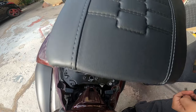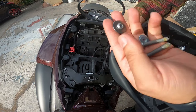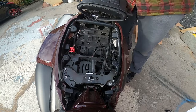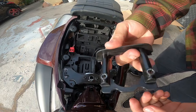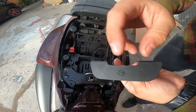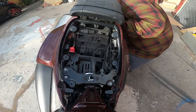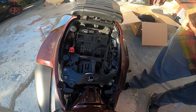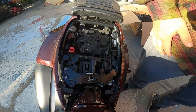Now we can go ahead and install the seat — go straight in, and then on the back you will see three bolts: one, two, three. That's where the three added bolts they gave you go. The one with the two smaller washers — those go on the outside, and the big washer goes on the inside. The spacer goes on the inside of the rear, just like this — there's a little Harley Davidson emblem and that's gonna face the back. Just find the one with the bigger washer first, and then the other two. That took me way longer than I thought it would.